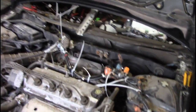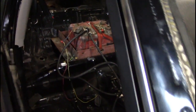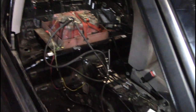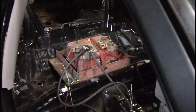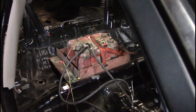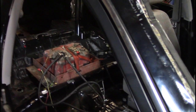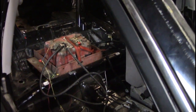After installing the window bar, we ran the fuel lines and hooked them into the stock fuel line location, running them all the way back to a fuel tank. I had some problems finding fuel lines long enough so I didn't really shoot it for the video, but it's super easy to do. I installed my gas tank holder — I'm running a very small gas tank because this is a four-cylinder. The one out of the Mazda does not have a return line, so it will not work in this Honda.